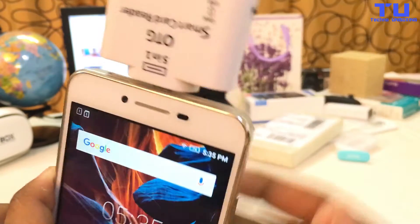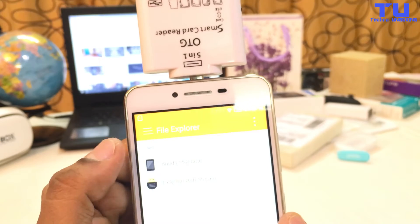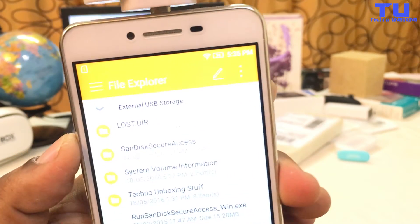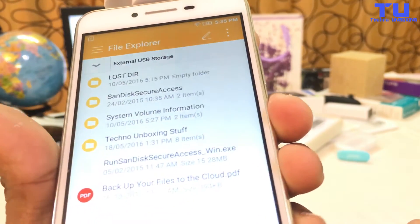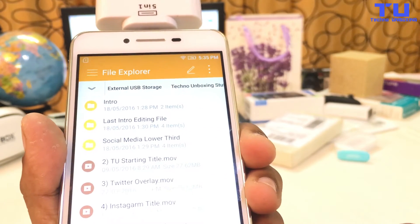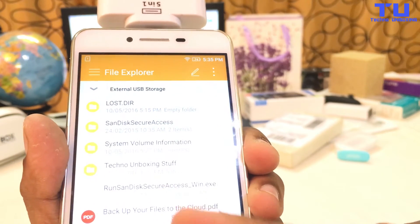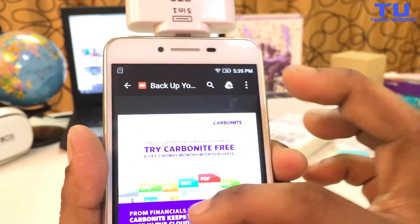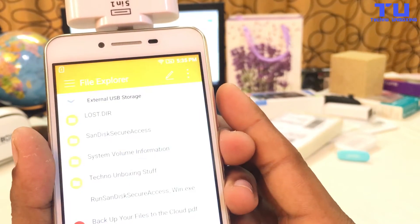This is one of the most typical ways to use USB OTG. It's possible to couple your smartphone or tablet with peripheral devices such as a mouse or a keyboard, which you can then use to control it. There are some restrictions — for example, gaming mice with a billion buttons might not be fully compatible — but for the most part, basic operations are enabled. Just plug in a USB mouse and you will automatically see its cursor appear on your display. This is also a great way to use your device if the touchscreen is broken.